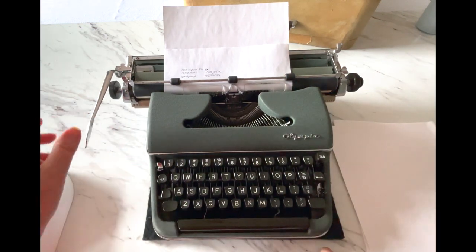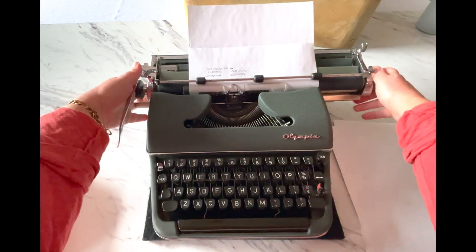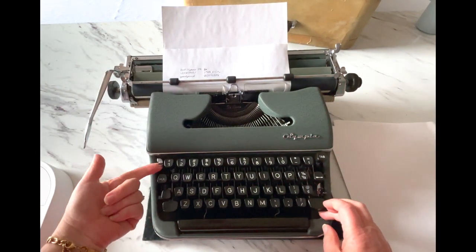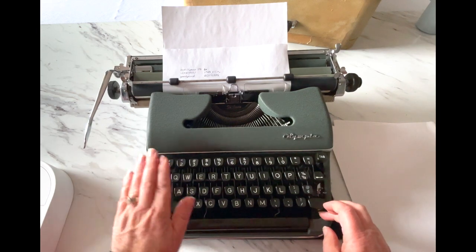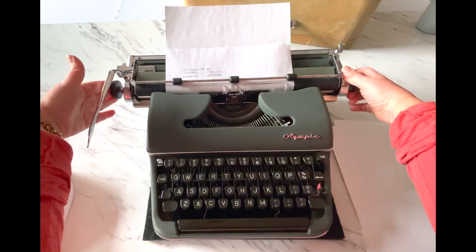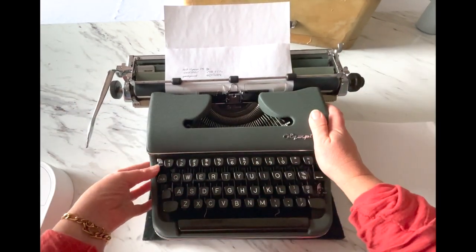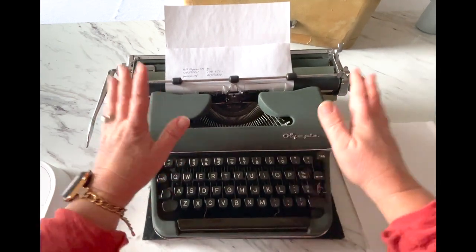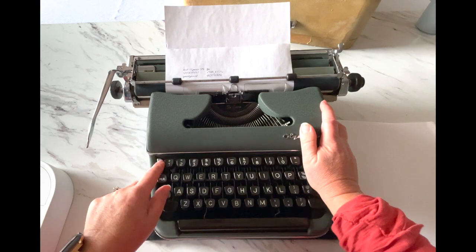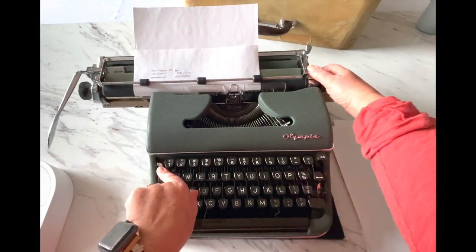Pull and adjust your paper, then make sure you re-engage it. Also, sometimes if you order an Olympia or you're storing it, there's a carriage lock — that lever is right here on the keyboard on the left side. What that does is lock your carriage so it can't move, which is great for storing or shipping. So if you get your typewriter and the carriage isn't moving, check your carriage lock, pull that down, and it releases the carriage.